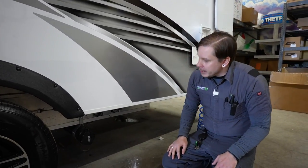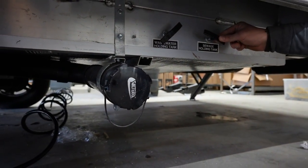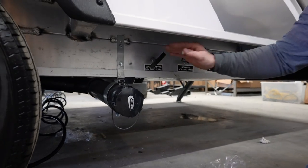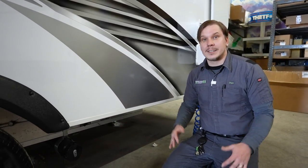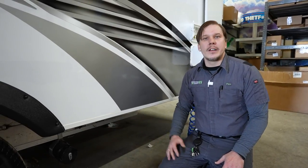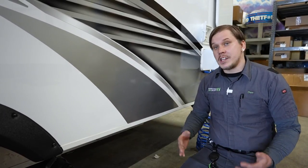Now for dumping wastewater. The handles are labeled on the body — the sewage holding tank contains body and solid waste, while the gray water tank contains sink and shower water. Keep both valves in the closed position and use the onboard monitor panel to check levels. Only dump as necessary, especially the black water tank. You want to keep body waste and toilet paper in as wet a condition as possible so it evacuates cleanly when dumped.